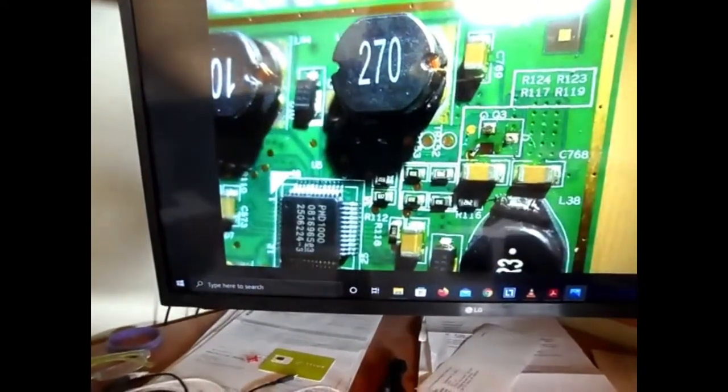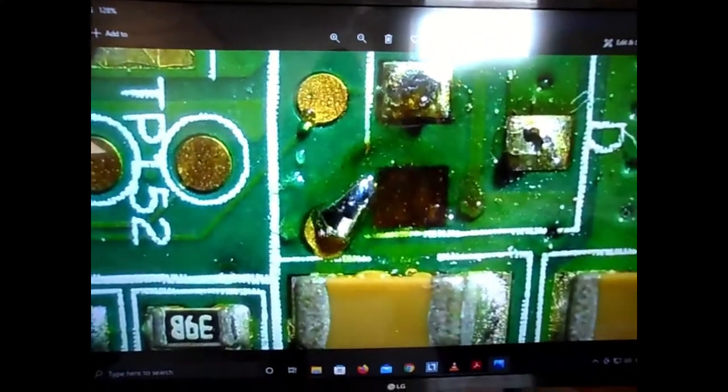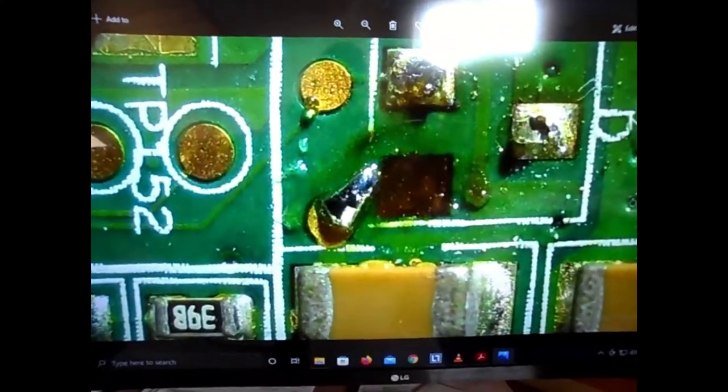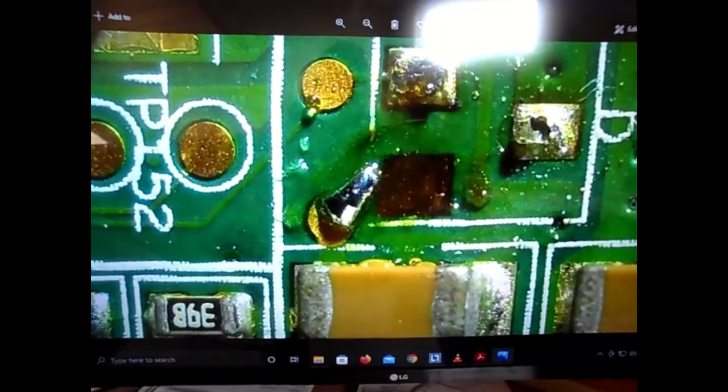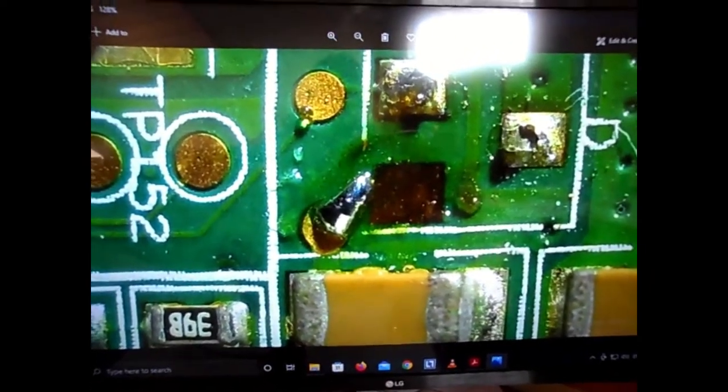This one, I think. So here's a solder bridge I built. You can see right there, I went from the test point. Also, I scraped in here and I just blobbed the solder over. And then when I put the new chip on, I just went directly to the leg of the chip in this next picture here, the final picture.